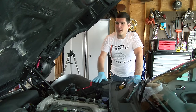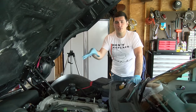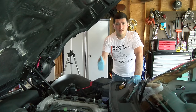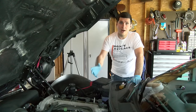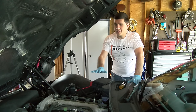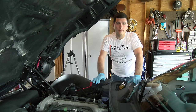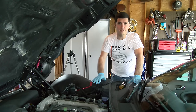The electronic versions, however, have a different setup — they have to be told when to turn on and off electronically. That's done with a temperature sensor and a relay. The temperature sensor gauges how hot the car is; once it gets to a certain temperature, it throws the relay and turns on the fan. So there are two places we're going to look: the relay and the temperature sensor. One of those two things is very likely going to be our culprit, so let's start with the relays — that's going to be the easiest thing to test.